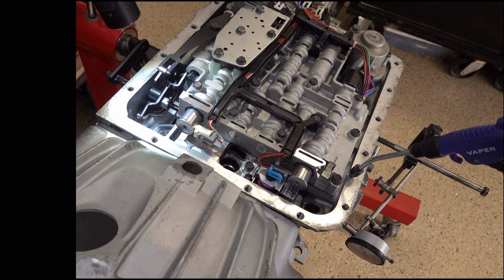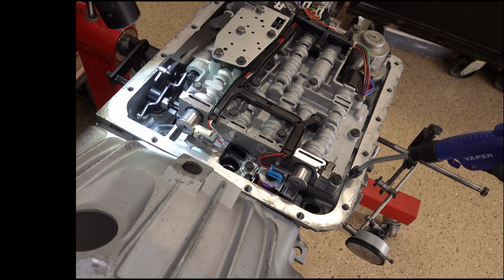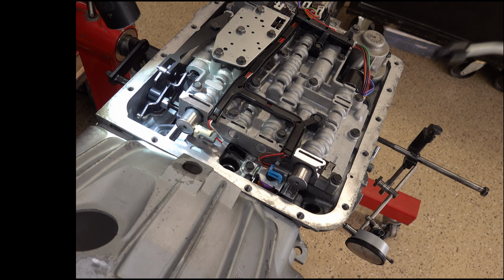All right, and a well sealing circuit is such that when you put air in and let go of the nozzle, it takes maybe a couple of seconds for that air to fully exhaust. Like I said, this nozzle sucks, but you get the idea.